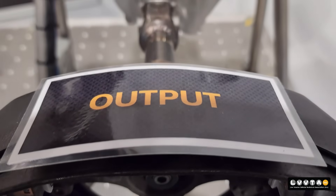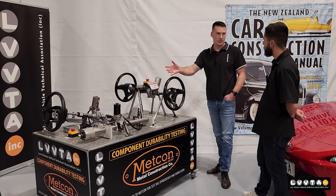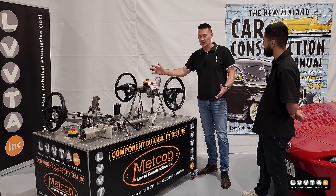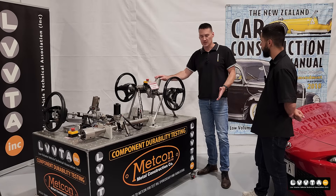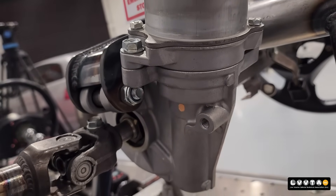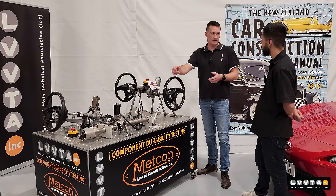What is EPAS itself? EPAS is an abbreviation of Electronic Power Assist Steering — we call it EPAS, it's just its nickname that everyone knows. Basically what it is, is an electric motor coupled to a reduction gearbox. It takes your input as the driver and amplifies it to the output, giving assistance.